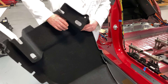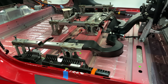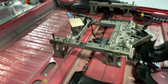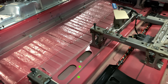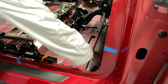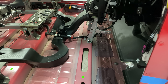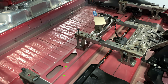What they're doing here is they're raising the floor so they can utilize the Model 3 pan. The pan here is going from the front of the dash all the way to the kick-up back here. We're seeing a couple of things that are different — there used to be a cross-car beam in there that's disappeared in favor of mastic, so that's how they're probably getting some of their stiffness and getting rid of NVH.